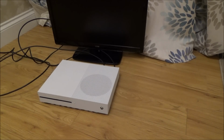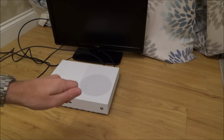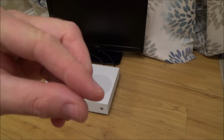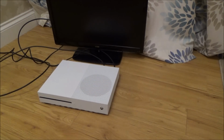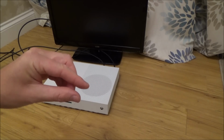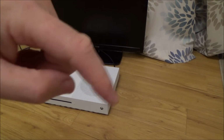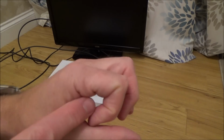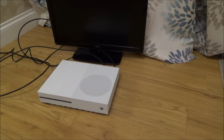Oh, right, okay, the moment of truth. So nervous. Just to tell you my thoughts beforehand, when I was heating it up and moving it around the place, sometimes it moved quite a bit. It'd be different if it was only moving like that much, but sometimes it moved about that much, didn't it? And I'm thinking that the solder, which was wet underneath, might have dragged. So although I didn't see any bridges on the outside, I'm thinking there might have been bridges on the inside between the massive ground pad in the middle and the pins on the outside. But you know, I might be lucky, I don't know.